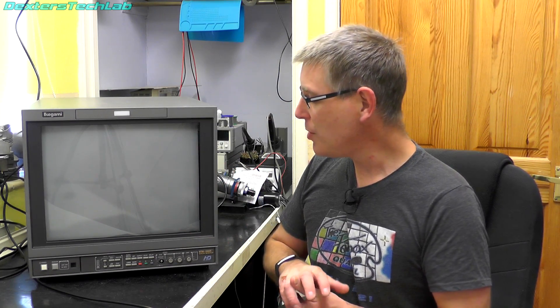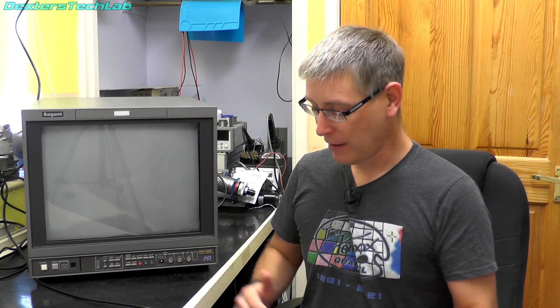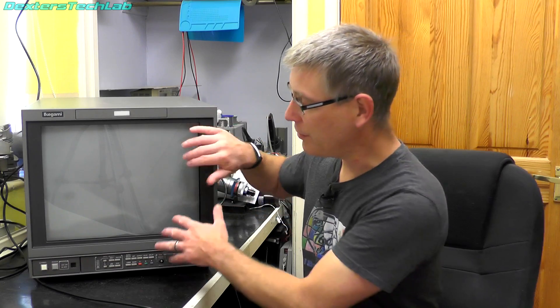Most of you will be aware of what a broadcast monitor is — it's basically a very high quality CRT used for displaying video. They've got a number of features that are very useful when working with things like Quantel. One of the most important is the underscan facility. With normal analogue TV, there was always an area of the picture you couldn't see — always beyond the screen. Things like games consoles always fit within that area. But with Quantel, because they were working in the broadcast industry, you could operate the entire screen, so if you show a Quantel paint box on a normal TV you'll be missing a load of stuff around the edges. The underscan feature allows you to shrink the whole picture onto the screen, which is really useful.